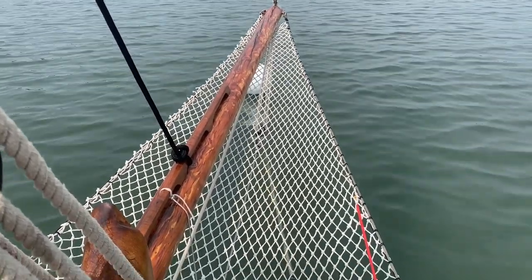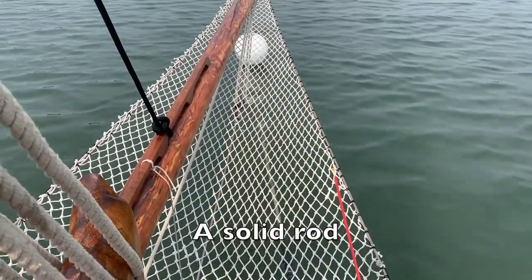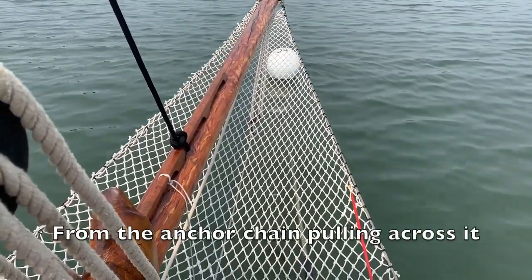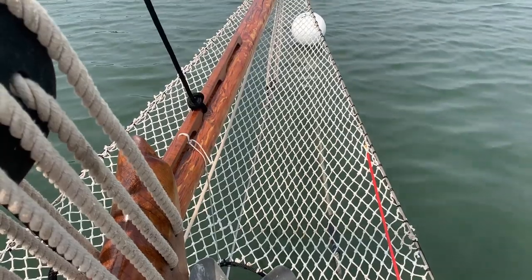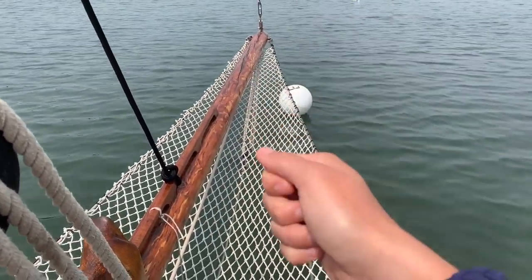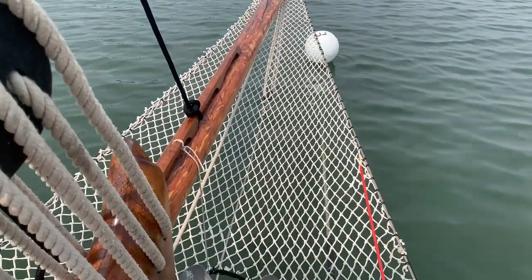Pete got the purchase correct on the bobstay fitting. Last time we tried to do this, a few years ago — Norna has a solid bobstay usually, especially if we're going out to sea. But because of anchoring, that solid bobstay was bending and getting messed up. We tried doing a block and tackle the full way and it would just twist and wouldn't work. So we got a piece of cable made with a block and tackle at the end to tighten it. That works well, and we can loosen it so the anchor line doesn't drag across and cause problems.